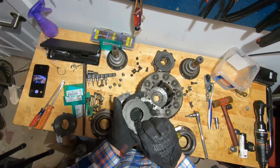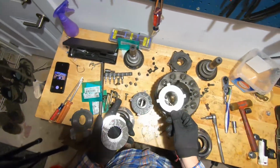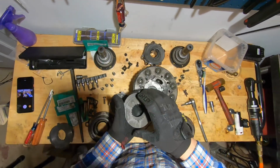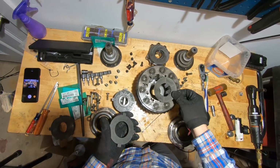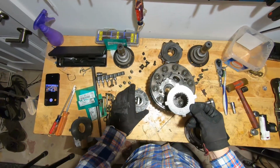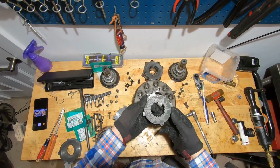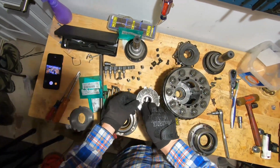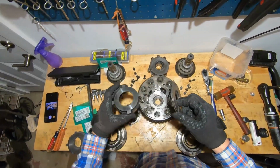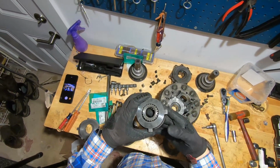Next up is a dog-eared plate. So this again is in place of that spacer. So we're just gonna let that guy slide down there. Next up, clutch, followed by another dog-eared plate and another clutch. So the thing about doing these is you don't want to just drop them in, because the next up is this guy, which houses this gear with its spline sides.